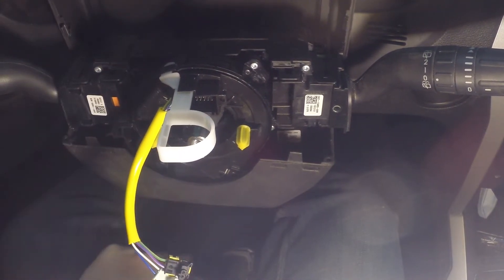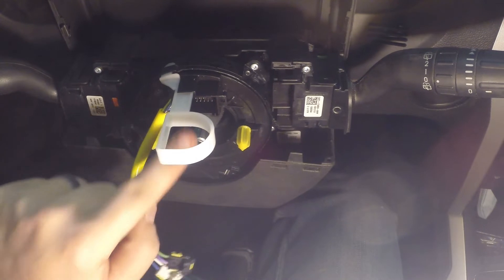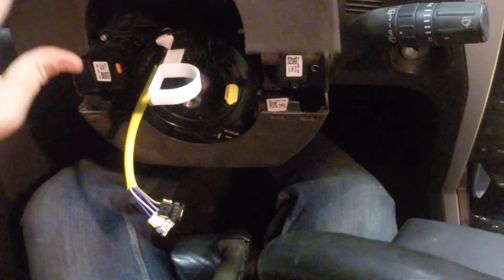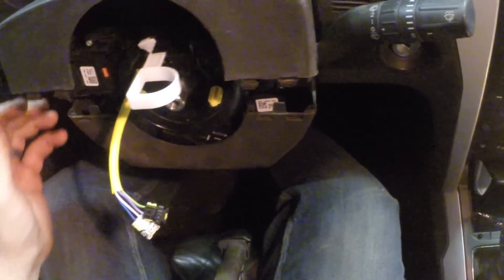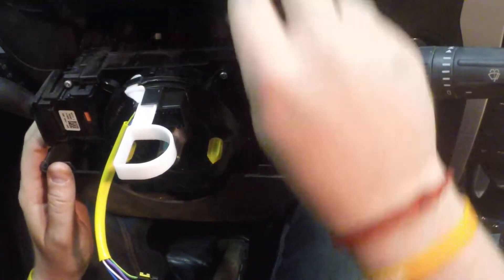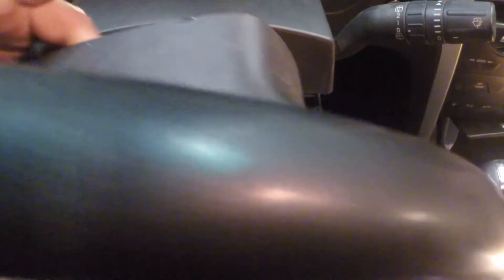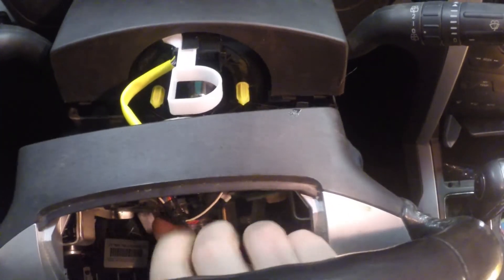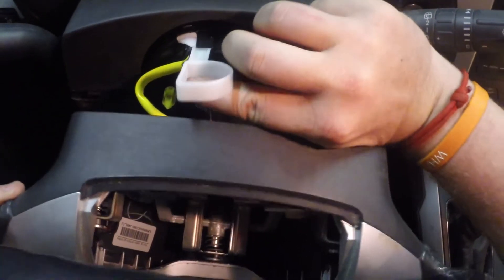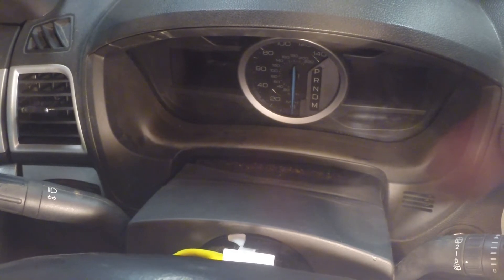Going to plug in the battery, come back, plug in the steering wheel, and check that steering wheel functionality is restored. Back in the car — pull the steering wheel out a little to give some room. Lightly set the steering wheel on the steering shaft, pull the connector through so there's some slack, plug it in, and power up the car to test steering wheel functionality.